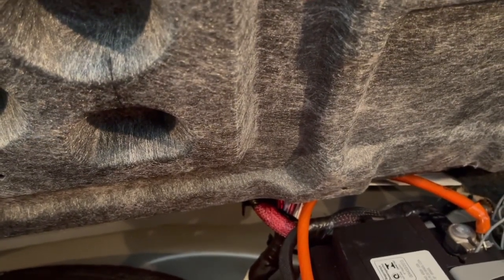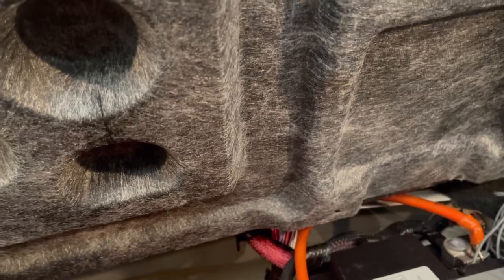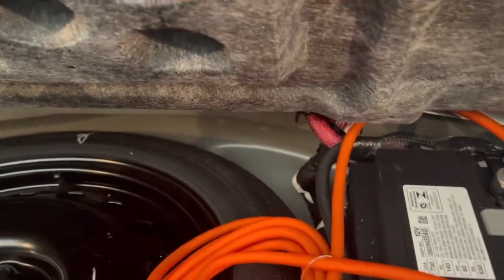I have some wire splicers in here somewhere. I'm not sure where they are exactly, but that's pretty simple. It's just a little piece. You'll run the signal wire into one end and then clamp it down on the wire you're trying to tap into, and it'll tap it. Nothing else is necessary other than that. It's actually really simple. You can get them from AutoZone.